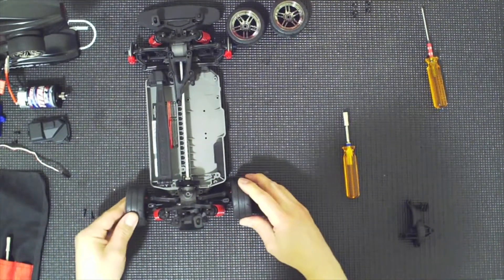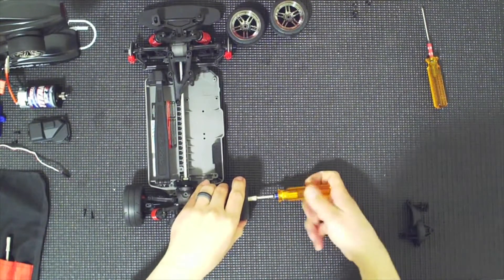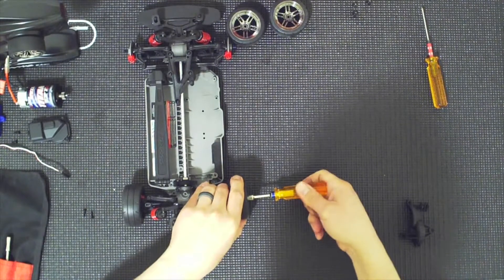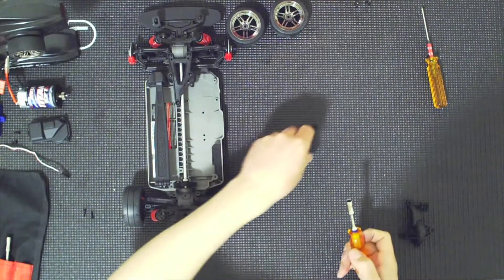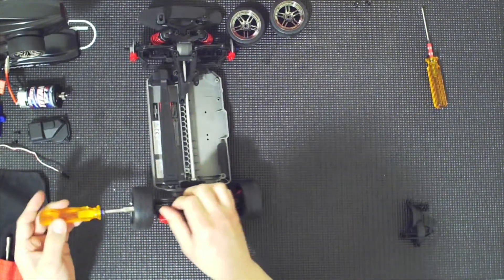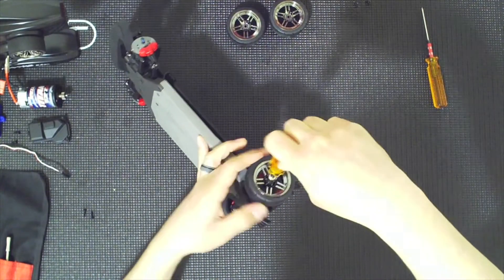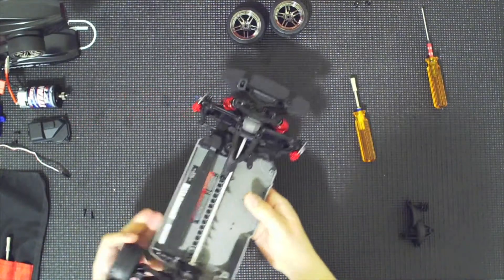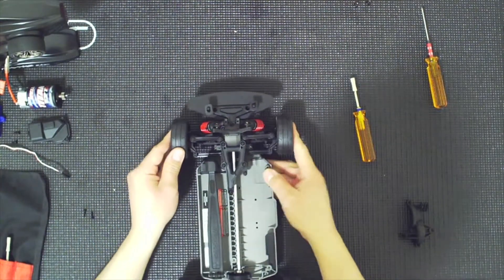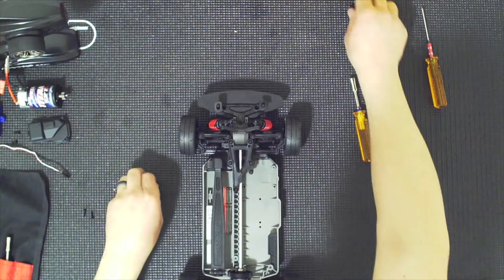You should do them one by one. I'm placing both just so the car sits level on both sides, but ideally do one at a time — especially if you're not using a block or a stand to hold the car up. Use your seven millimeter driver and you can hold the tire or spin the tire and hold the driver. Just remember not to over-tighten. If a nut keeps falling out, do not over-tighten — you're just going to damage the plastic on the wheel or the hex. You can compress the plastic and your wheel will get stuck. Get serrated nuts instead.